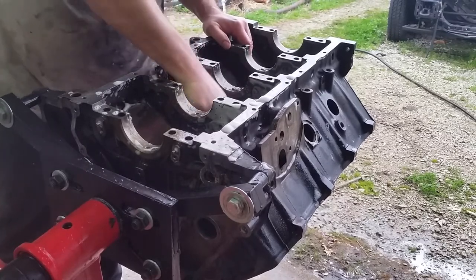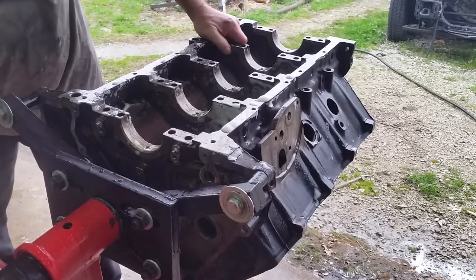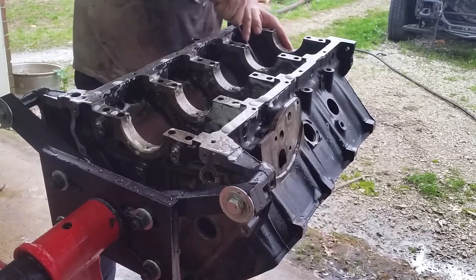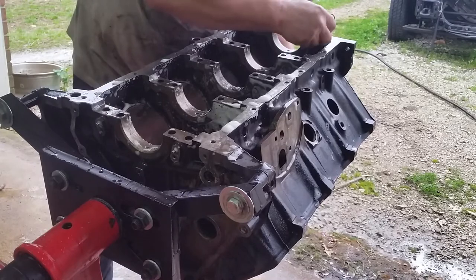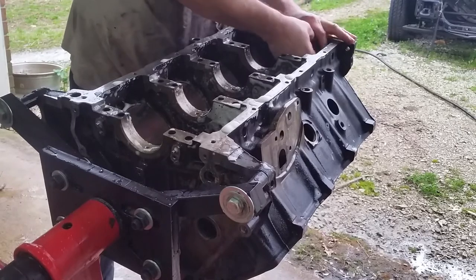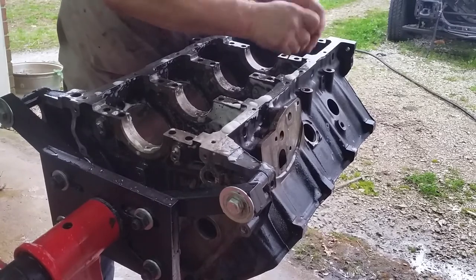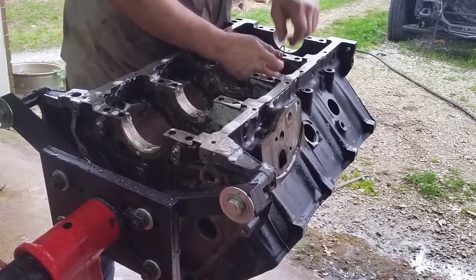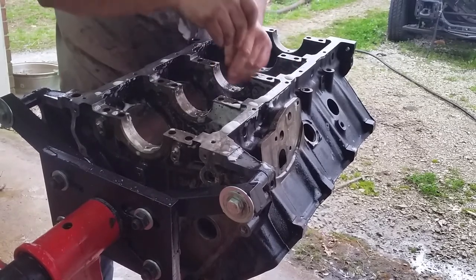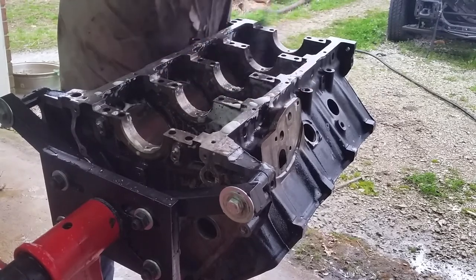But I could not get complete contribution out of all the cylinders. I run Auto Ingenuity, which is actually really great software. And could never get the contribution on 7 and 8. The two back cylinders. Just would not, mess with them. Under harness wiring, under valve cover wiring, new glow plugs in it, had six bad glow plugs.